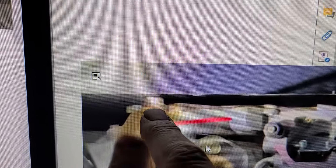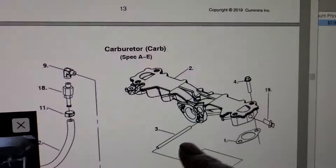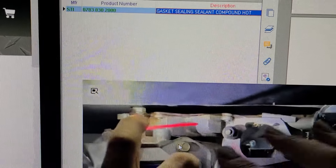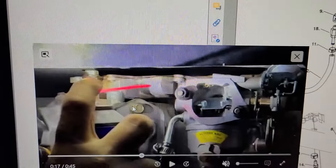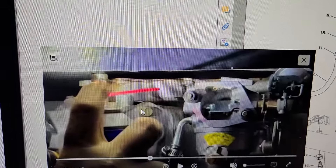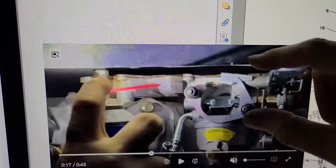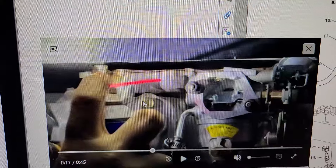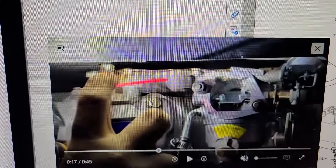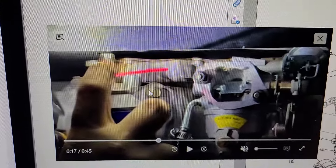The next concern is whether he'll have enough room to get the intake manifold out. There are four bolts holding it — two on each side. You can see 'quantity four' right here. My concern is the big fiberglass top box on top of the engine may prevent him from getting it loose. Maybe if he can just raise it up an inch or so, or drop the generator a few inches. I'll find out after he does the repair and add that to the notes.